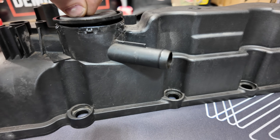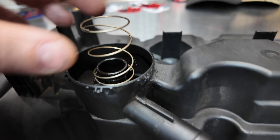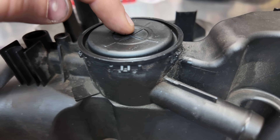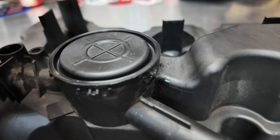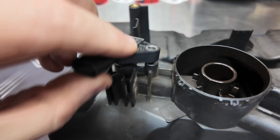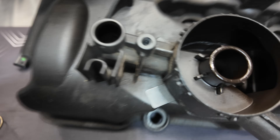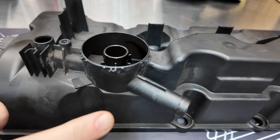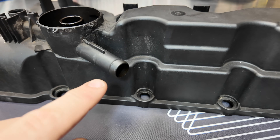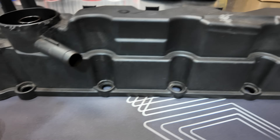As we go down with it, there's very little gap inside there. What's happening is the spring is pushing up while the turbo is actually trying to pull it down. So there's a constant battle that the diaphragm is doing to modulate how much is going out there. Now this hole right here is where the crankcase pressure sensor goes, and it is actually always measuring how much crankcase pressure is in there.